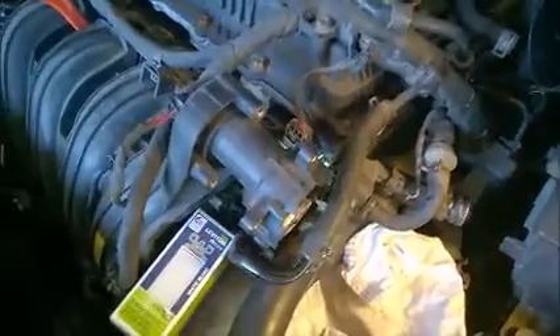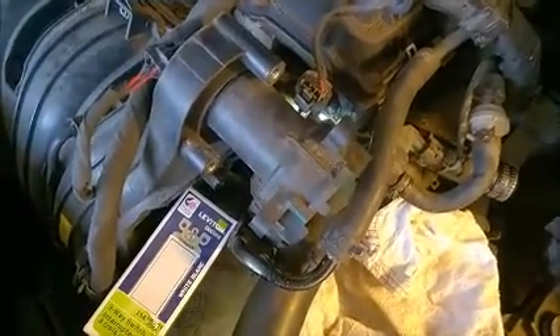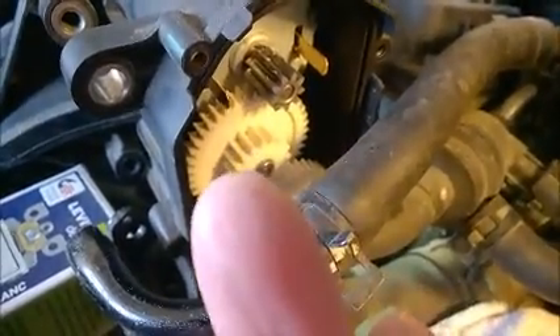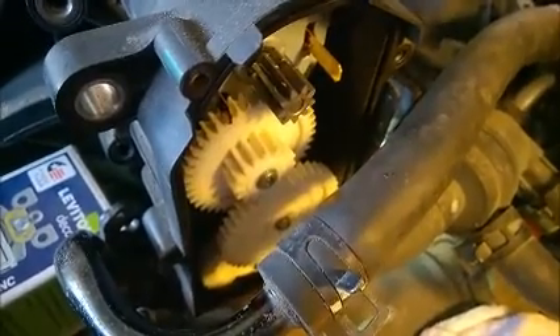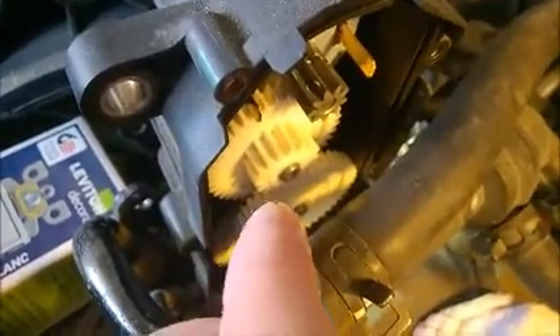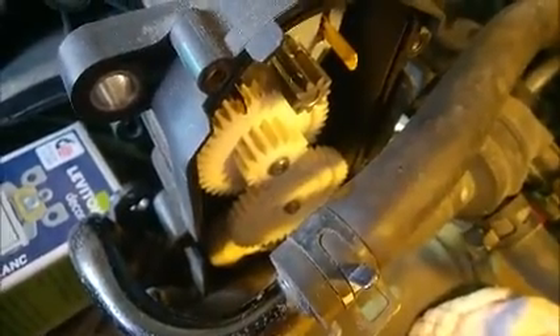The motor - depending on how stuck things get - my engine is still driving perfectly well, just a check engine light. I did not drive it after the check engine came on. I could tell the plastic gears - there are one, two, and a third at the bottom difficult to see. I'll explain how to access the top gear in a moment. What I think happens when something gets stuck: after the VCM locks up, the plastic gears no longer turn. The electric motor with the metal gear will try to force on the plastic gear and will start stripping it. By the way, you can just slide the center plastic gear out of the shaft, and then the top one - they just come out of the shaft.